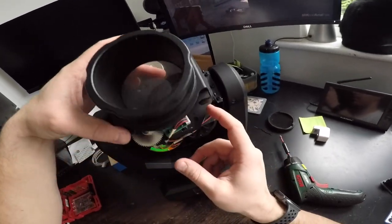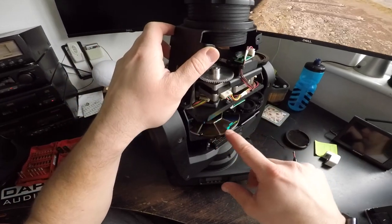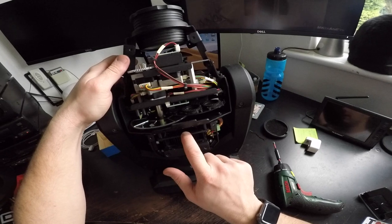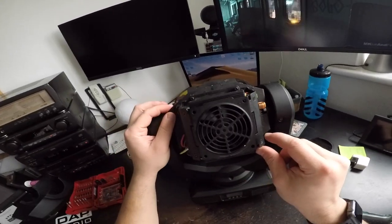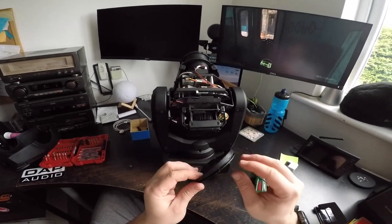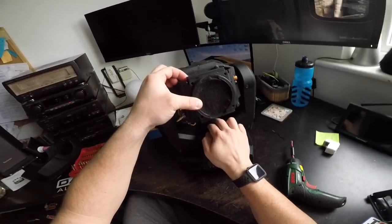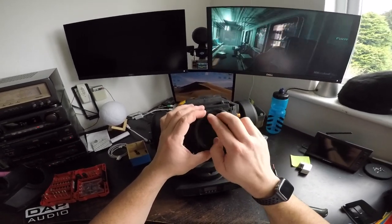If you look closely on this prism here, it's really foggy — not transparent. There's a focusing lens and then there's this color wheel which I wiped yesterday. Under here it's full of dust and crap, and there's an LED lens that gets dirty. Usually this LED cooler gets filthy with dust inside and gets really clogged. To eliminate that problem I made these filters — I 3D printed them, created from scratch. They go like here, and this indentation clears the space. The filter is just a normal piece of foam and it helps a lot to keep these clean.